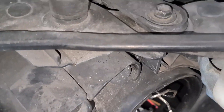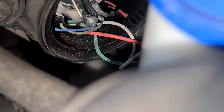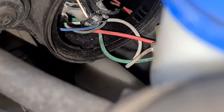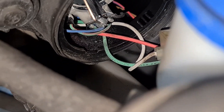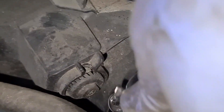Now what I'm gonna do is get the new bulb and slot it in to the locator. That's one, that's two, and the single one is on the top. That's how the bulb sits in. If you fit it incorrectly, like on the other side, the beam image is really bad — that was the reason it's bad. So I'm gonna slot the new bulb in now — you can find the link for it in the description.